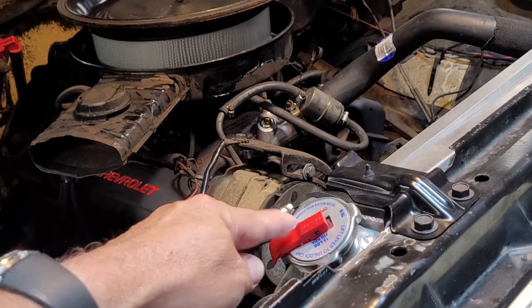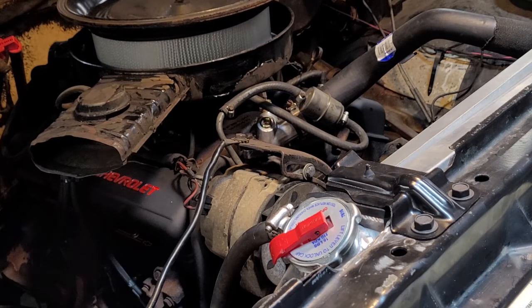Stant makes a really good one — that's what this one is here — and I think they're a good investment, just a few dollars to eliminate the opportunity of something really bad happening. The wiring harness I used is a pretty good one from Painless — it's got three relays. One relay for the first fan, which it calls 'low.' If it doesn't start cooling off and the temperature rises more with the first fan running it'll kick the second fan on. The third relay is for AC — you can hook it into that relay and the minute you engage the clutch on your air conditioning compressor by turning the AC on, it will turn a fan on. Very simple to install, very precise and good instructions with good labeling. I think it was a good investment as well. Y'all have a great day.